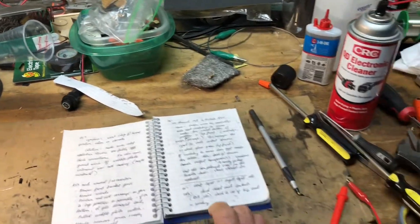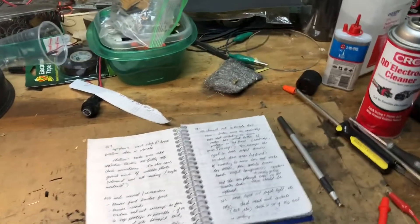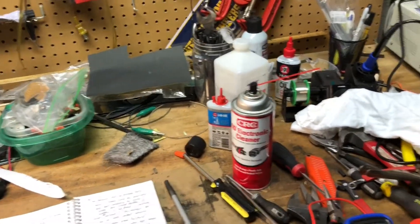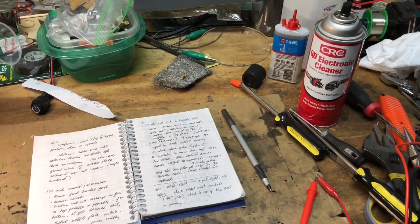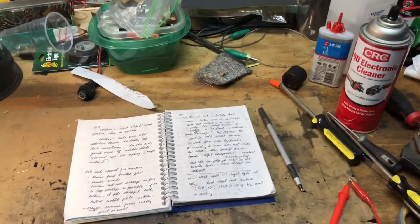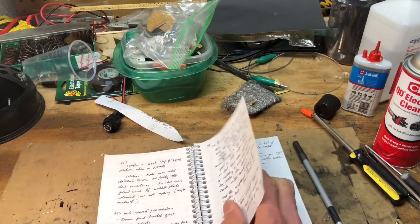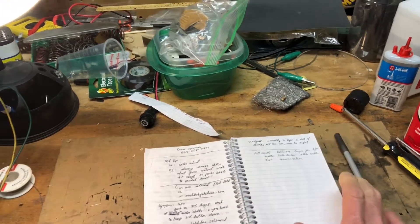How about if you press your first digit and the first digit light won't come on? Certainly check the light, but that may be the credit unit contacts — go in there and check those ADR contacts. That ADR relay in the credit unit is involved in a lot of passive and active connections, and that would be where I would look. If everything looks good there, then go over to the selection control panel — I said that board never went bad — and look at K6 relay and see if it's working, then trace things from there.